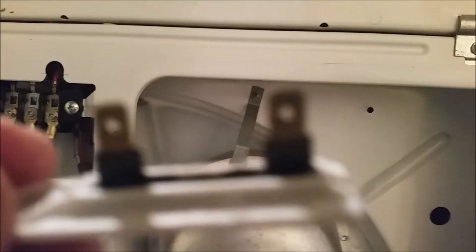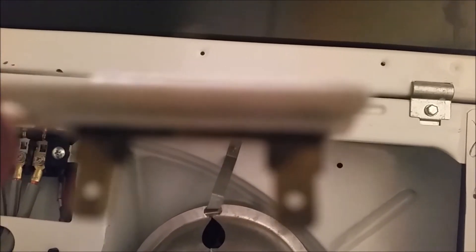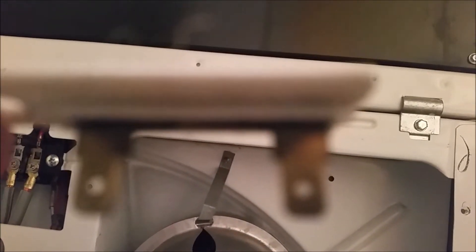To remove the high limit thermostat, just remove the screw and wiggle it right out of its fitting. Same thing here - remove the screw, it slides up and out. And that is what it looks like on the inside. You can see it has collected some dirt and dust, but other than that it's done its job. See right there - those burnt edges? That was the telltale sign before testing that it was bad.